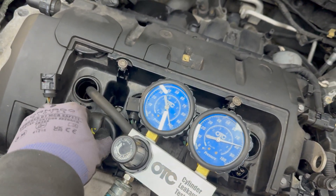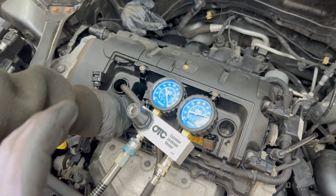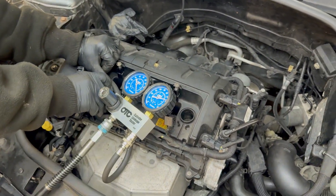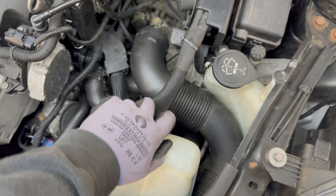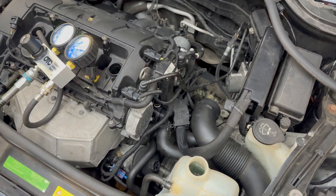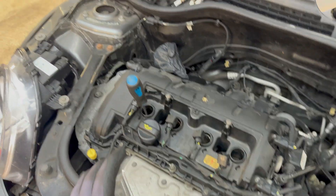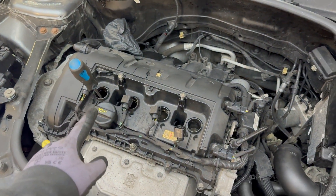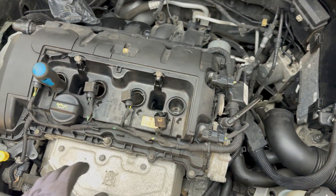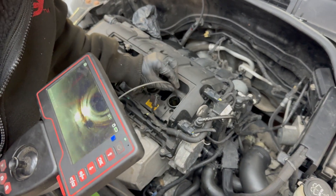How is that possible? Basically, it is normal that the engine has a tiny bit of leak down — it doesn't seal 100%, so the piston rings allow some air to pass through them, ending up in the crankcase and coming up underneath the valve cover. I can take off the coolant cap and it won't be bubbling. We've checked off-camera and it wasn't bubbling even from cylinder number four. So we are going to further investigate — we are going to inspect the cylinder with a borescope. We'll need to move the piston down, so Dan is going to turn the engine.